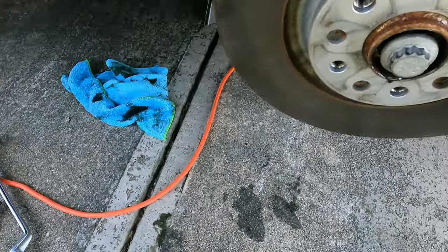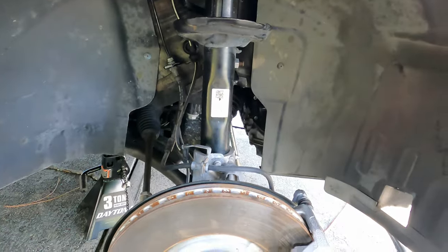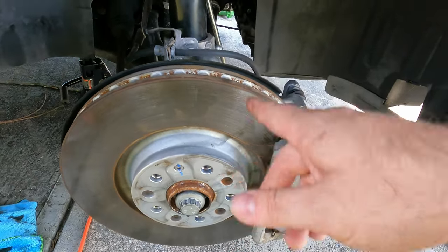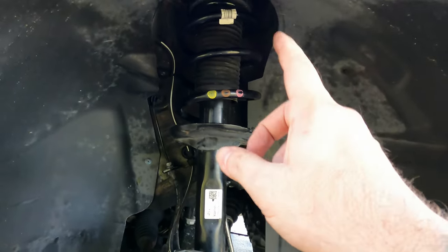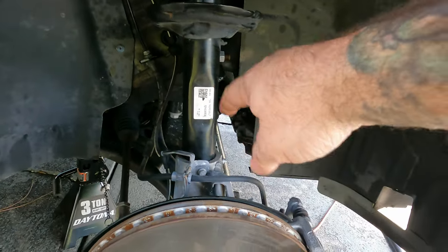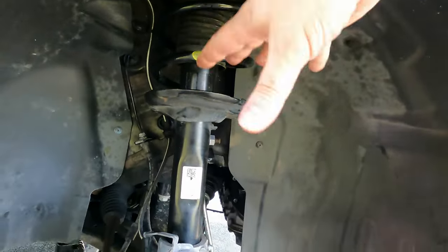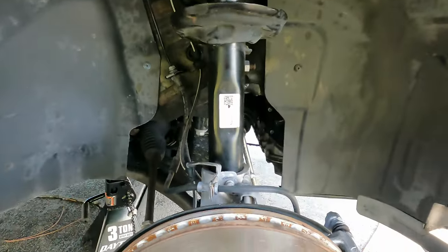There's a little bit of a mess on this side, but it wasn't as bad — we were able to get it in quick enough. But because the strut's an inch and a half taller, we couldn't get it back into the spindle, so we did have to pull the lower control arm off as usual and pull the axle out temporarily to get it all back into place. Rewind back to the other side where I secured the top three bolts first — don't do that on either side. This side, we put it into the spindle first, which was much easier. Once you have the top secured, you don't have a lot of room to move the strut around. Get it into the spindle first, then get it back up into the top once everything is secured.